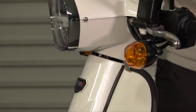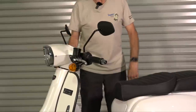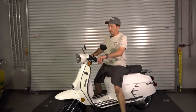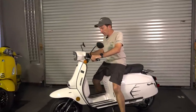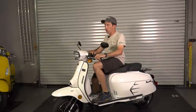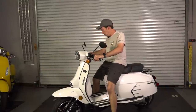Moving on to ergonomics — in many ways I feel it's a pitfall. I'm about 5'7"–5'8", and if you're any shorter or your inseam is less than mine, I think it's going to be a difficult scooter to ride. The GTS 300 is also a fairly tall scooter, but the ergonomics on this could use improvement. It comes with both a center stand and a side stand with a safety interlock switch. I can easily flat-foot it on both sides, but if you're about 5'5" or shorter you may have difficulty supporting the scooter flat-footed.